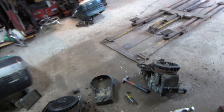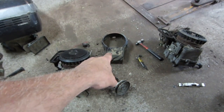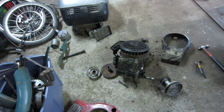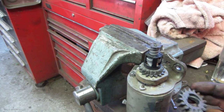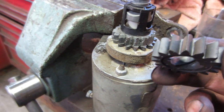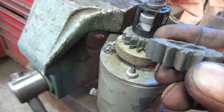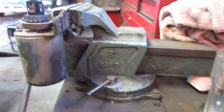I need to deal with the carburetor and figure out which one is better. I also need to reassemble with the starter motor. You can see the starter gear is barely there — not much left of it. Here's the replacement one: one end has a flat to it and the other end has a taper. We're going to try changing this out on camera.